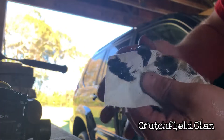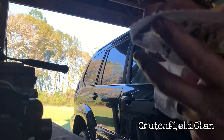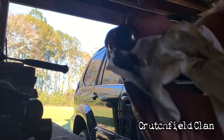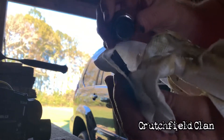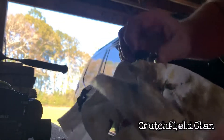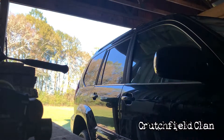It's not the worst I've ever seen. Clean it off and see how much sludge — there's no actual large chunks of metal, but whatever is in there is magnetized. It is metal, so that metal sticks to that magnet, and you can kind of see what condition your differential is in. So let's put this back in and get some new fluid in.